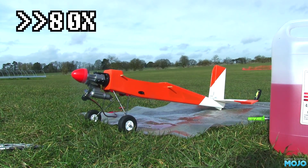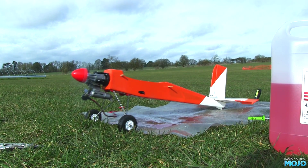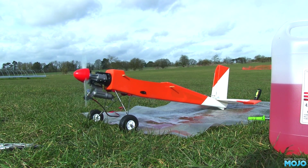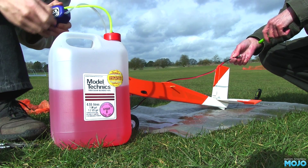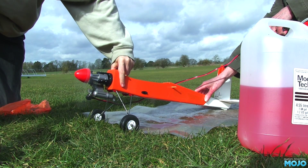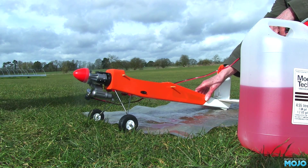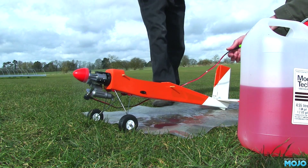Going to skip ahead as watching an engine for 10 minutes isn't the best footage. Let's try letting it idle - not bad at all. We'll let it cool off again and fuel up. Now we should find it will start up almost right away. After 15 minutes or so of running it should be fine to lean it off a little bit more. We still want a nice burble, nice and rich, then let it run for another 10 minutes.